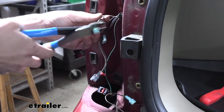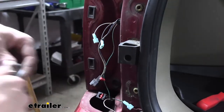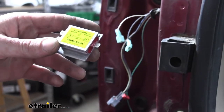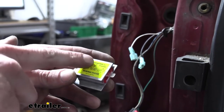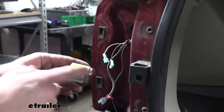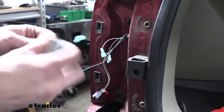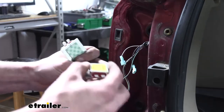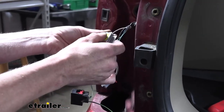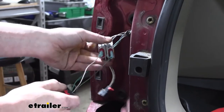Once we've got all of our spade terminals crimped on, we can grab our diodes and plug those in. Now on our diode, you'll notice that it has an in and out on it — that's important because the way diodes work, it only lets voltage pass through one direction. If you were to put it in backwards, it acts as an open circuit and current doesn't flow through. There are two ins on the inside and one on the out. The outside is always going to go to the bulb because we want our current to flow into the bulb to light it up, which means that's going to be on the connector side. So on our connector side, grab each one of your wires and plug it into the outside of your diode. We're now going to reconnect our wires back together — purple and white here is going to go to purple and white, just plug that into the inside. So we've got those diodes in.